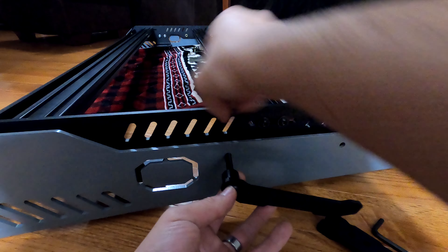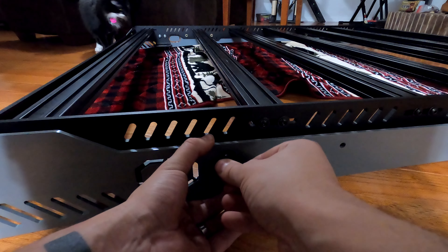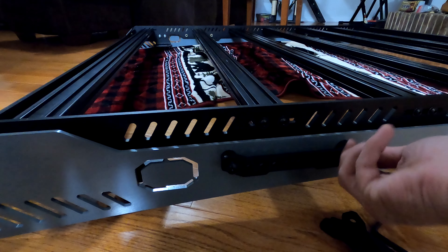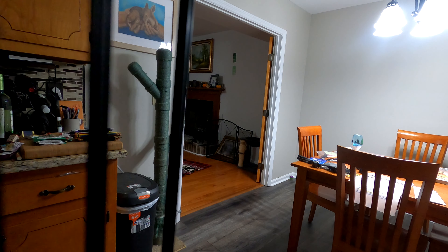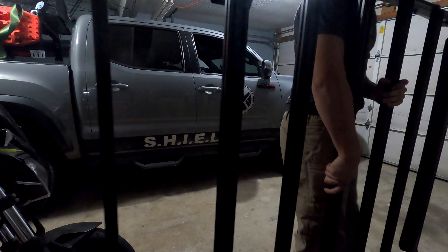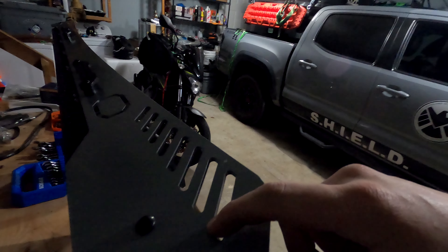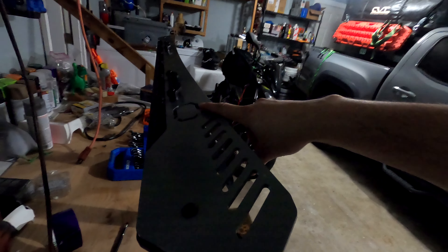The Armor Tech aligns along the edge and gets threaded into the little hole inserts. Holes one through four will be filled with these spacers and bolts once we install the grab handles. The install on the side is super easy — bolt with a five millimeter, then a spacer down in the center, and it lines up very well. I'll get this done on the other side and then move on to prepping the truck.